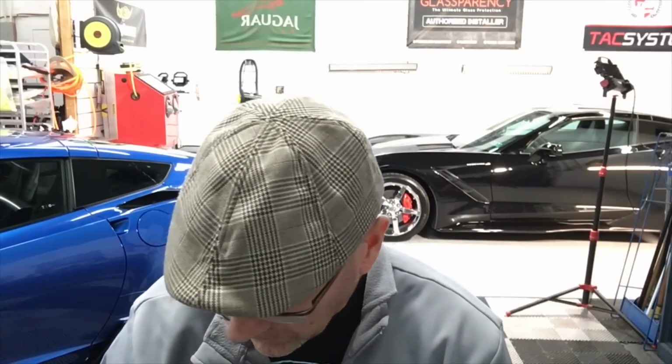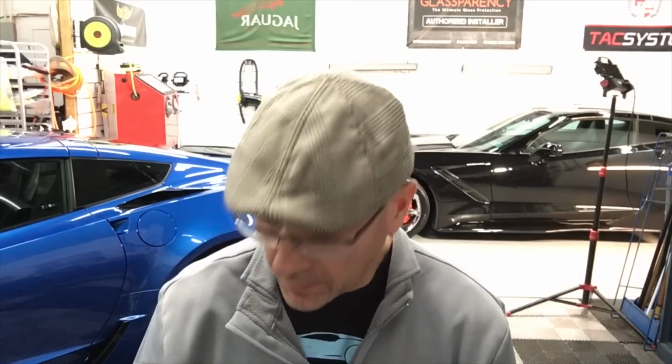Okay, next question goes to John Pivovarnik, and he's working on an '03 Corvette. Yeah, of course, that's going to be stubborn clear coat. I love working with hard, stubborn clear coat. I'd rather have that any day over soft, which can be a real pain to finish up. It can fight you, hard to wipe some of these polishes and compounds off, and if you have the wrong media to wipe off, it can re-scratch it again. So I'd rather deal with these guys any day over some of the soft clears, although soft clear really does look fantastic when it's finished off right.